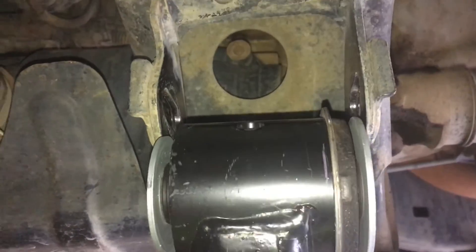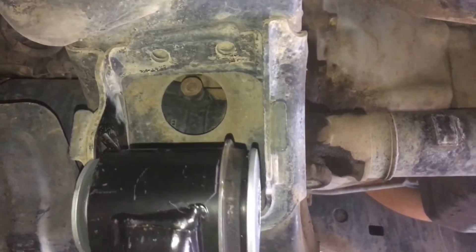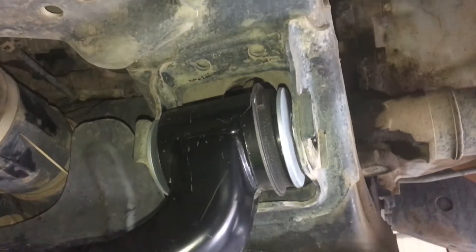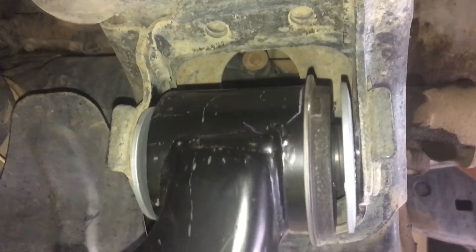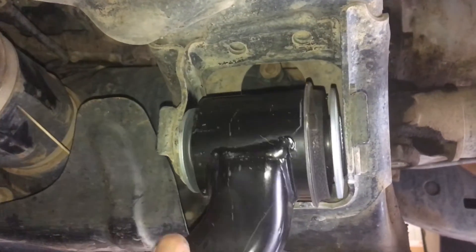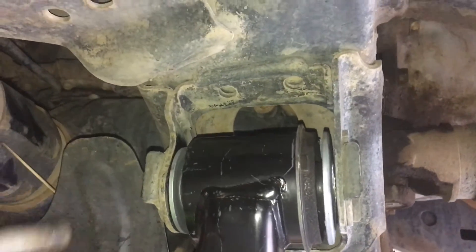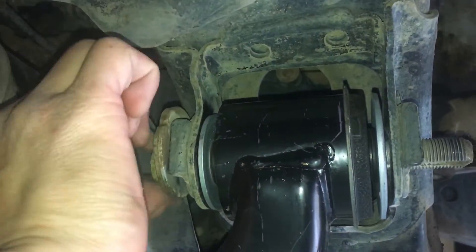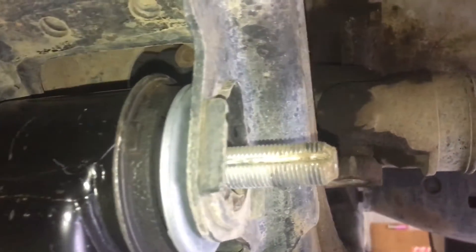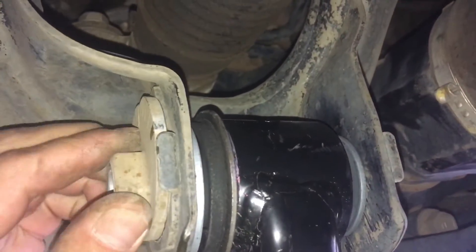That's how they just slip back into position. Just gently slip them in — they're not usually too hard to get in, unless someone's pressed the bushes and bent the arms. That's one of the downsides of changing the bushes — they can be stuck really badly. It's expensive to replace the genuine arm, but it's over 300,000 Ks, so it's like small money over time. So you get that up in position, and obviously that's the bolt that goes through there — spin it around, beautiful. This bolt at the back is the one where you undo the nut — do not try and turn this bolt because it's located in here. The rear one is the nut.